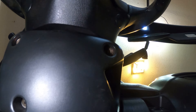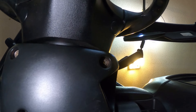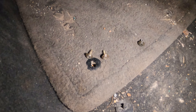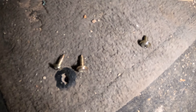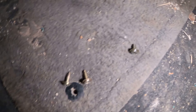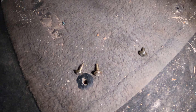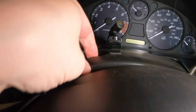The first thing I'm gonna want to do is take out these three screws — one, two, three. All of them are Phillips head, or actually they're probably JIS screws, but Phillips head is gonna work. The two that go in the front holes are the same pointy coarse-thread screws that are effectively everywhere in the interior, and the one in the back hole by itself is a fine-thread machine screw. Definitely keep those sorted, though I think it'll be fairly obvious if you put the wrong one in the wrong place.